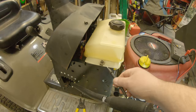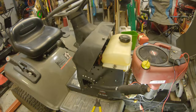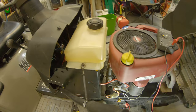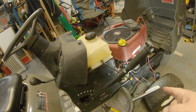Then just find a good ground, someplace where it'll make your meter beep. Or if you're using a test light, run it to the battery — make sure you've got that hooked up correctly. Since we're using a meter, I've got one wire on the kill wire. I'm going to put the other lead here underneath this bolt. When it makes continuity you can hear that beep. At this point, our key is off. When the key is off, it should have continuity on that wire, and it does.